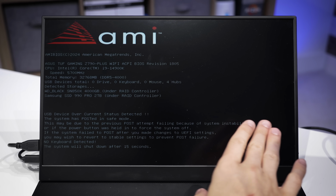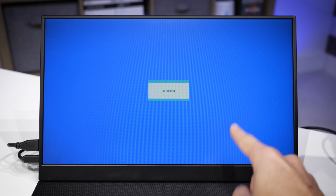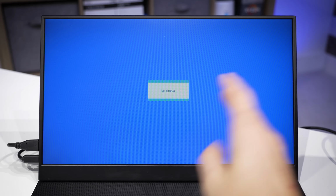I have tried every single slot on the motherboard with our working stick, and, well, okay, that didn't last very long. It's doing this because it sees the USB overcurrent and shuts off, which is actually a good thing. But we were getting a post consistently with that DRAM DIMM in every single slot, which tells me that he probably has a defective module, maybe more than one.